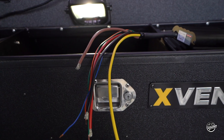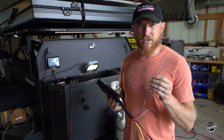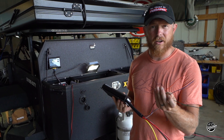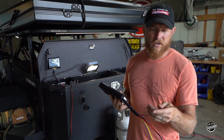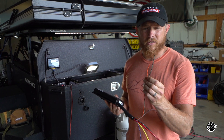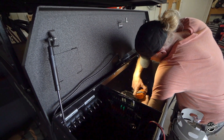Then we have these smaller wires, and they do a couple of different things. Really what you need to know most is your blue wire is an indicator wire, so if you have any sort of light set up. And this green and these orange — with these, what you need to know is that if you are putting in a lithium battery, these need to be run together.